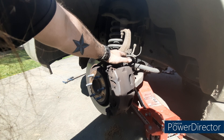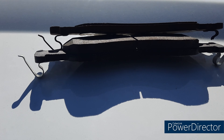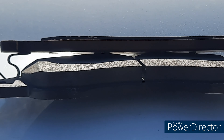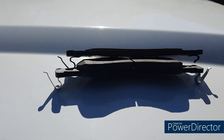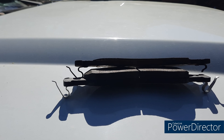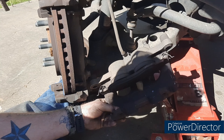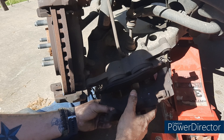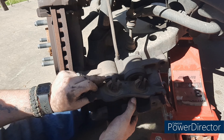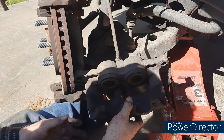Sometimes it can be a little pain in the butt. The light out here isn't great, but you can see the thickness difference between the old pad and the new one. I've got the pistons compressed here. When you go to put the back pad on, it's got these little tabs that will actually lock inside of the pad.